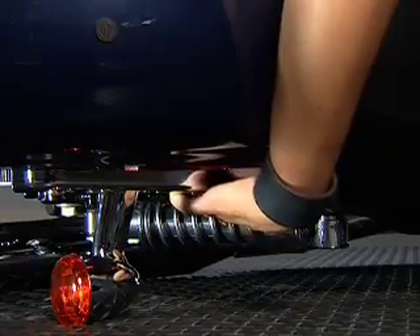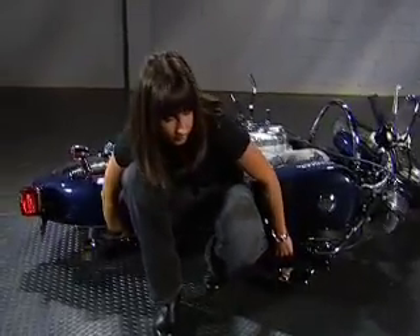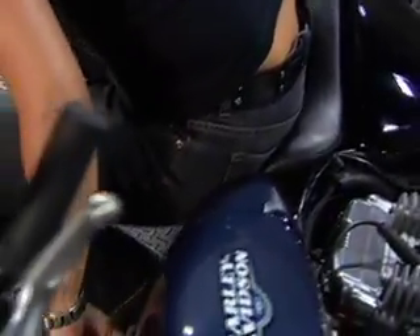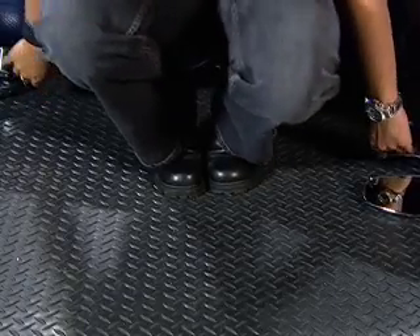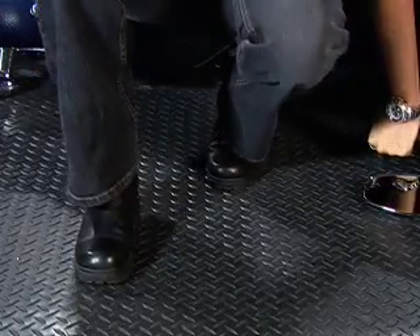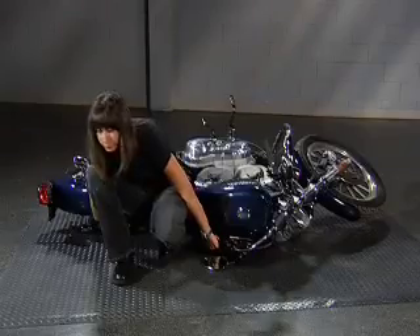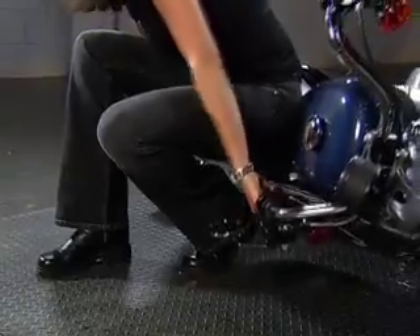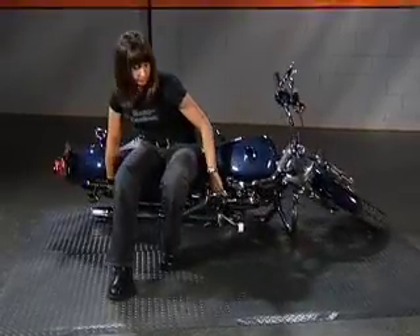Grab the back fender, the fender strut, or the sissy bar if you have one. The key to understanding a lift is that you aren't lifting 500 pounds straight up — you're pushing back against the vehicle's weight. Much of the work is being done by your butt pressing against the top edge of the seat. The position of your feet also matters: for some body types it works best to keep feet side by side, others find it best to put one foot in front of the other. Find the combination that provides the most leverage and is most comfortable. It's good to start with a slight rocking motion rather than a single mighty jerk — the momentum you build by rocking helps to lift the motorcycle. Remember to push backward with your leg and butt muscles; don't rely on your back and arms.